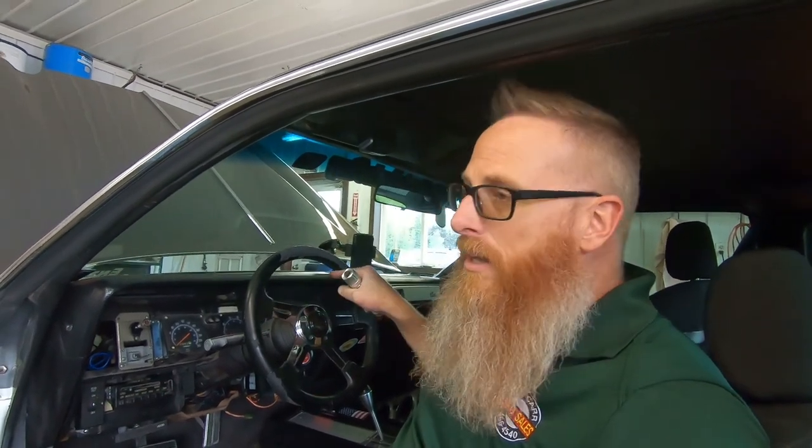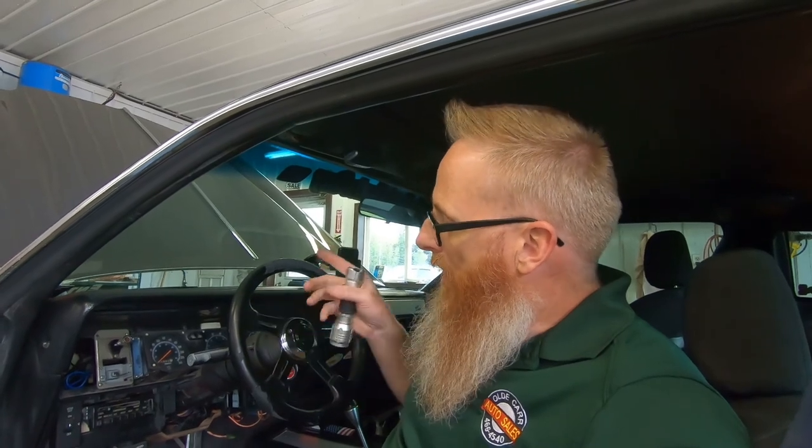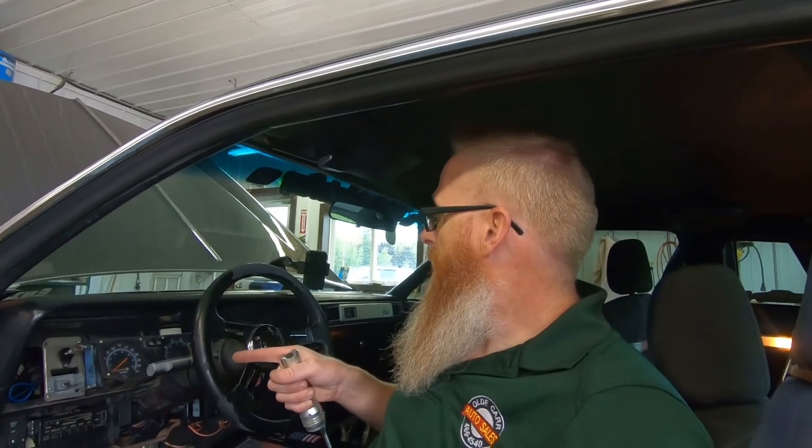When I unplugged the harness and looked at the pin, there was an empty slot. So what did we do? We filled that slot with a wire and we're now in the process of running that wire out underneath the hood to grab a tach signal at the coil. We've tested it - the tach works! By tomorrow we should have that fully working, and now you guys know we're going to have a tach working for the dyno test this coming Saturday.